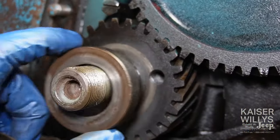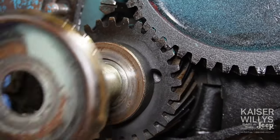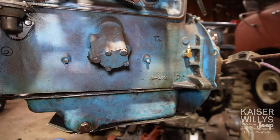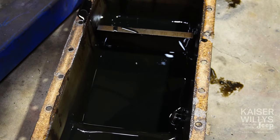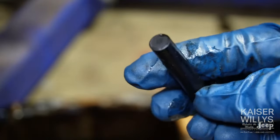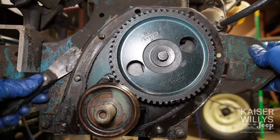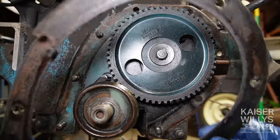While it's not necessary to remove these two parts, I wanted to show you the orientation and order in case they fall off while you're working. Use a half inch socket and remove all the oil pan bolts. I'd like to leave one bolt partially threaded in so that the oil pan doesn't drop and make a mess. Now's a great time to clean out your pickup tube and sludge from your oil pan. If any of these little rubber cylinders fall out of the rear main cap, just set them aside for later. Remove the old gasket and clean the surface with some sort of chemical cleaner to remove any oil or grease.